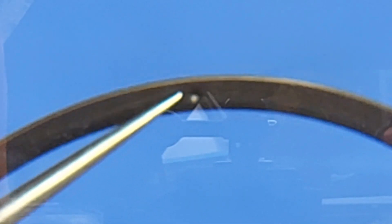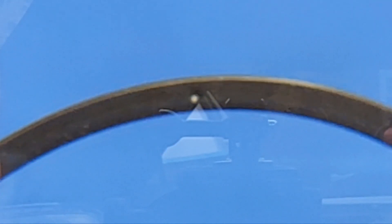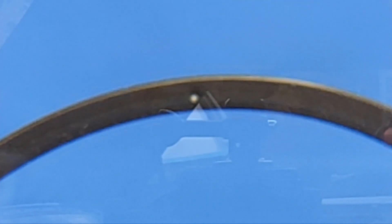This is the UEM R08 — this is a stabilizer ring for the oil control ring, and they put a mark on it. I've been referring to it as the bump — it's right there. Just so there's no confusion: there are similar kinds of marks on piston rings, and in that case the piston ring mark goes up on the piston, in the context of being in the normal running condition or position of the engine as it sits in the vehicle.